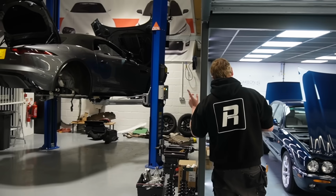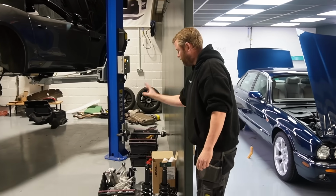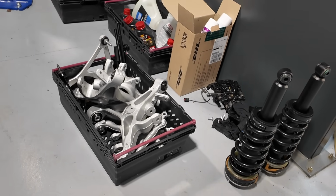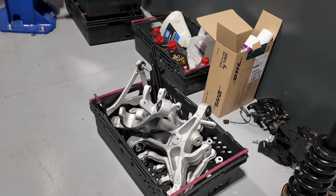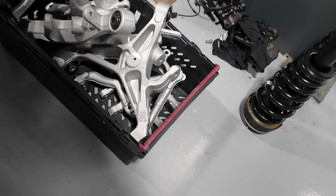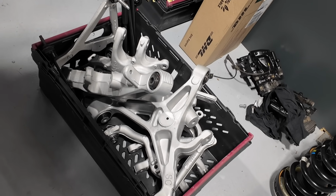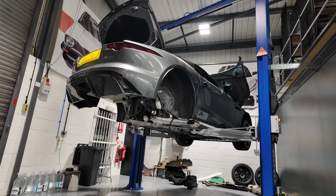We've now had back lots of the parts. I don't know if I showed some of this last week, but all of the aluminium castings, so the rear hub carriers with lower arms, etc., have all been bead blasted and then clear Cerakoted to protect them against that surface furring you get on aluminium parts. Then loads of the small parts and all the fasteners were bead blasted, went away for zinc nickel plating, and were then overcoated with black Xylan coating over the top of that. So they should be extremely corrosion resistant and resistant to damage.